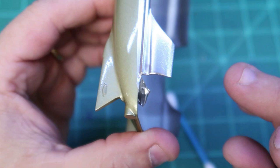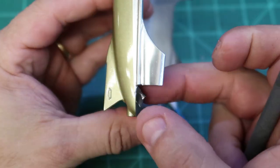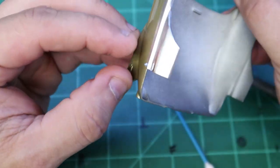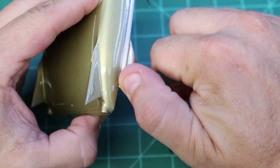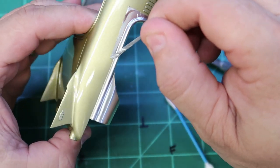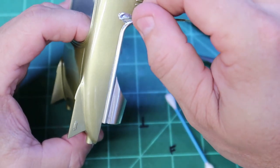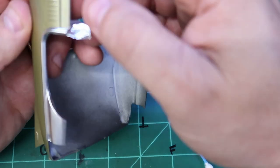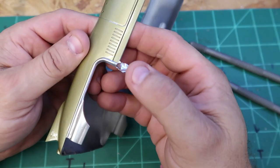Okay. And right back here, I want to take my knife and just roll it down under here. Now, with this piece that was left hanging, well, it came off. I was going to use it as a little pull. Now I take the dull knife, I'll grab that and ever so gently start to pull that off. And you can use your fingers if you've got enough. When you get on these corners, you just be really careful, so when you pull off, you don't want a portion to still be attached and ruin your chrome. Okay, so there's going to be a chrome piece of trim right here. So I can just remove.